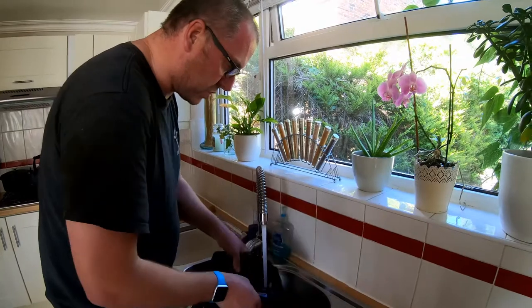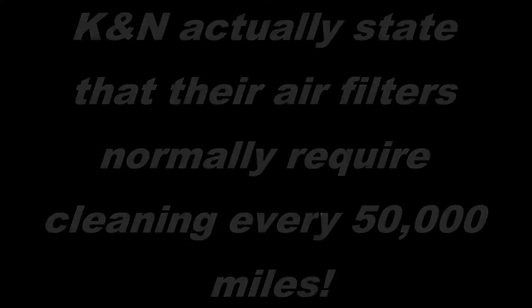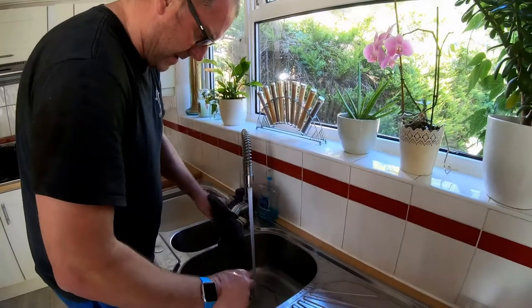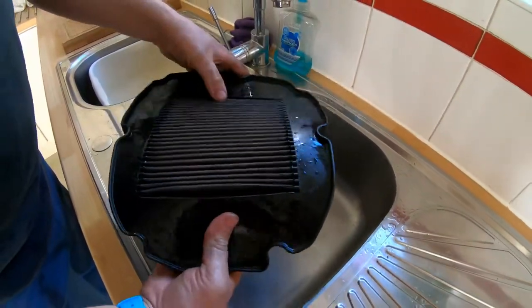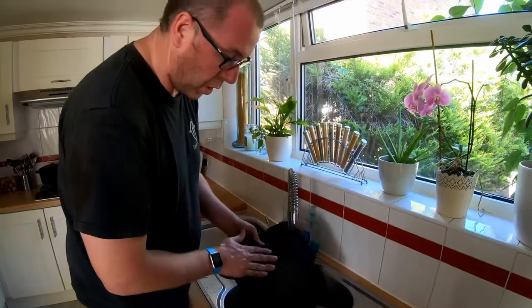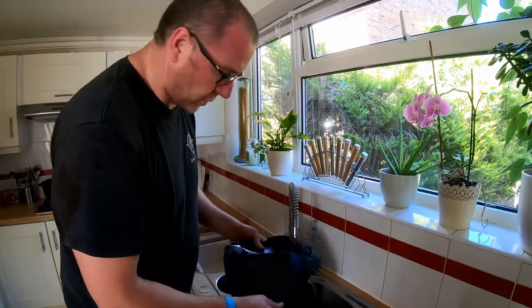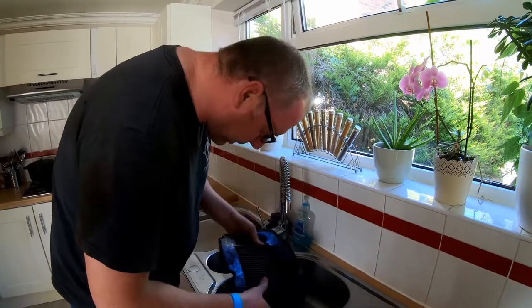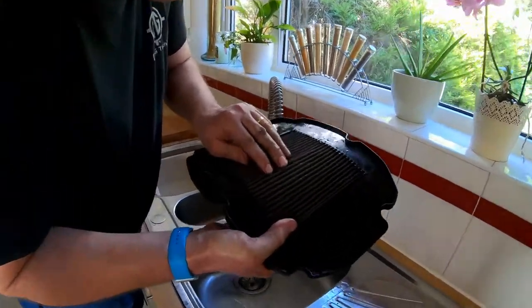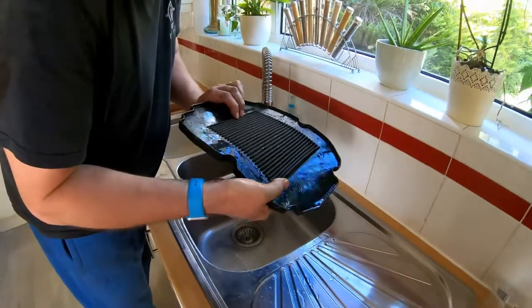This is basically the process that you do every time you would change your air filter. I reckon we're about there. As you can see, the pleats have gone a lot paler because there's no oil left on them. What the cleaner does is it's a solvent that helps remove the old oil. You can see they've got a bit of a grey colour, whereas when they're brand new they've got a red tinge — because the red tinge is, in fact, the oil. That looks pretty clean — I can't see anything in between the pleats. I'm completely satisfied that that is nice and clean.